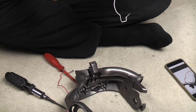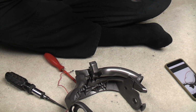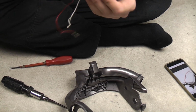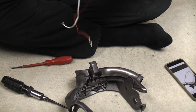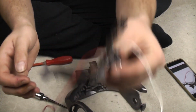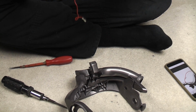By holding the part the same way, I know that the white wire goes on the inside, it just pushes, and then just need to push the little plastic tab down that I prized out, take the thing out in the first place, and the red one goes on the outside. Again, if you buy the repair kit, which is incredibly cheap for these because it's such a common issue, even the genuine Dyson one is a £5. It comes already on this. You literally just bolt this onto the machine, so you don't have to worry about doing this.